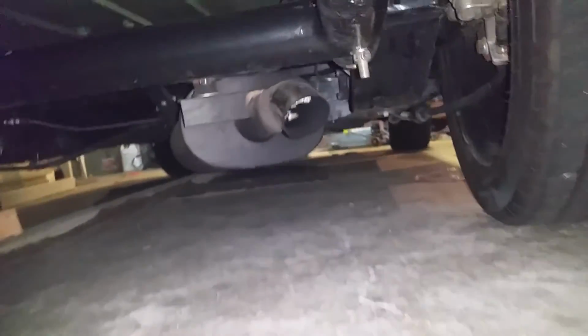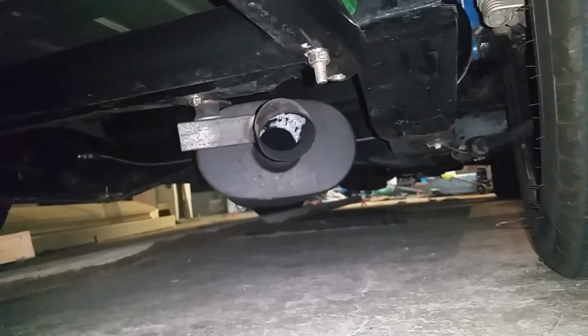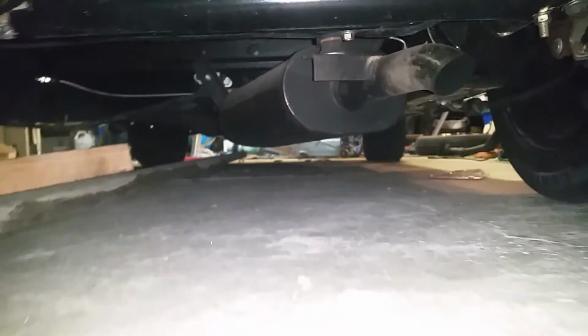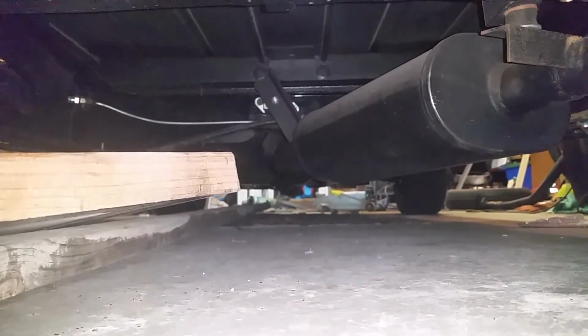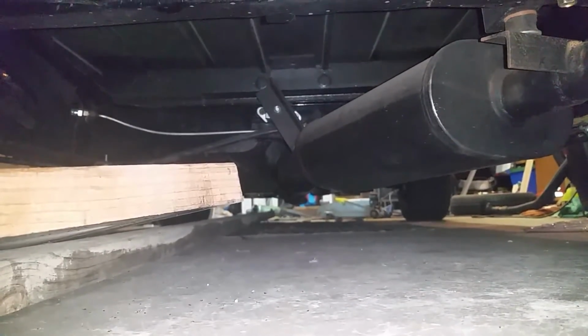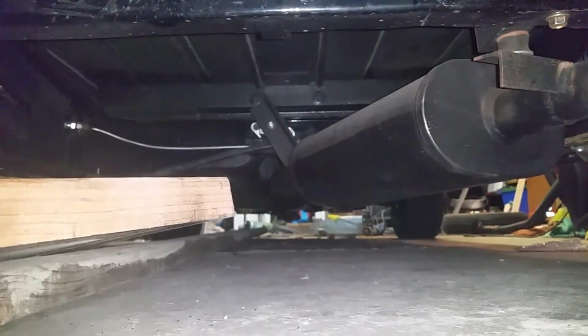Just brought you back here so you can see the exhaust. Probably get a bit of a sound there. She runs up, fits really nicely through the tunnel. We've got plenty of room, no dramas scrubbing on anything. It's quite good. It's got the catalytic converter right up as part of the engineering. We had to put that in, so right up near the gear shifter. Shortened linkages on the standard Honda shifter. Yeah, all seems to work all right.